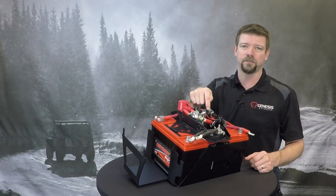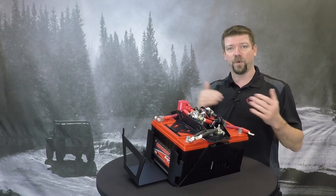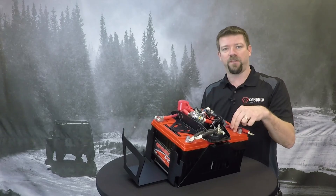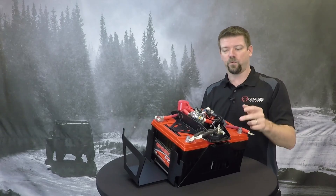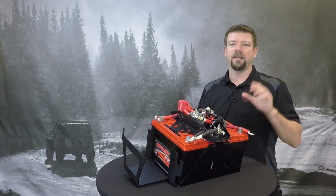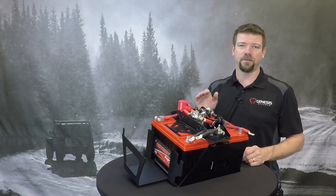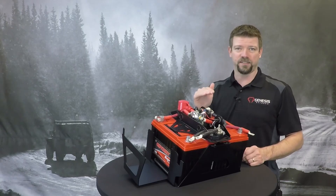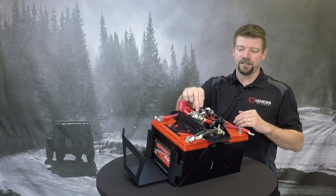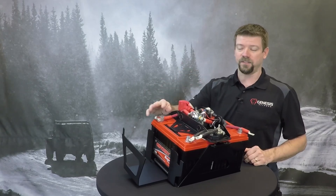The heart of the system is the little brain box back here. This little black box has a circuit board inside it that is constantly monitoring the voltage levels of the batteries to decide when to connect and disconnect them. When it sees your cranking battery above 13.2 volts for two minutes, it will close the contacts and link the two batteries together. They stay connected as long as the cranking battery stays above 12.7 volts — that's the threshold. As they drain down and hit 12.7 volts, the isolator will separate the batteries, and all your accessories will continue running off the second battery only.